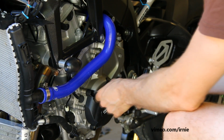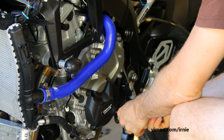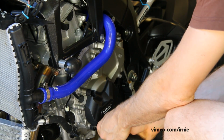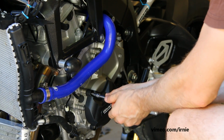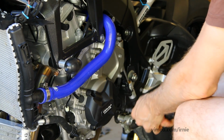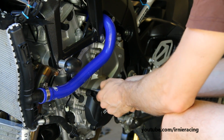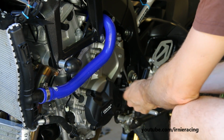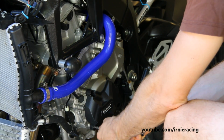Okay, so now when we torque them, it's all by hand, it's aluminum, right? So it's all by hand, 10, 15 foot-pounds. I'm not using any leverage at all. Most of my leverage is as much as I can do by squeezing it with a sore wrist even. You go around the circle until my hand starts to slip on this little thing. That's pretty much 10, 15 foot-pounds.